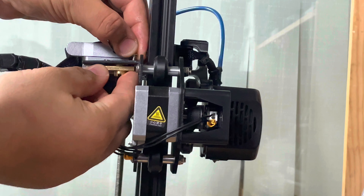Put the coupling back on — should be all right. Okay, it did go fine. I decided to bring the lead screw back into the coupler. Let's just screw it down and tie the coupler back. Don't forget to do that, because otherwise you will have unhappy times — it would be slipping on the spot and things like that.